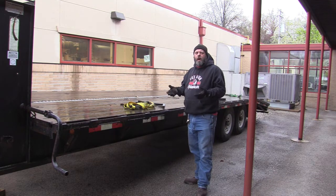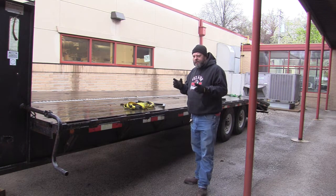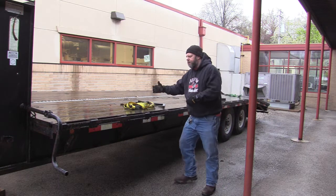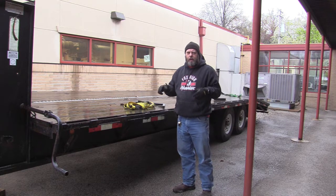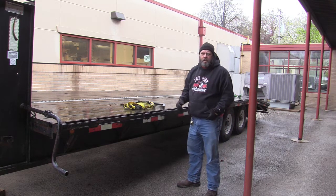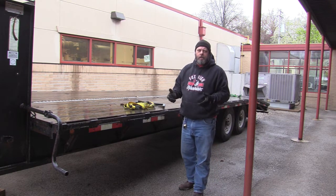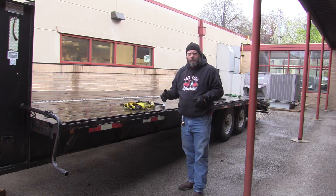What we have is a couple of five-foot side boxes for a pickup truck. We have to go with side boxes on this trailer because we don't have the depth of a dually that a semi truck would have to put true under-bed storage boxes. Make sure you measure the depth from your I-beam to the outside of the trailer — in our case about 13 inches — and we've got a couple of 12-inch deep side boxes. Typically truck boxes are 18 to 24 inches, so use what works for yours.